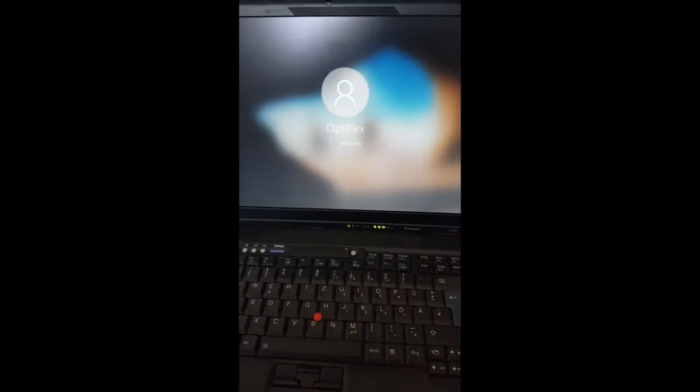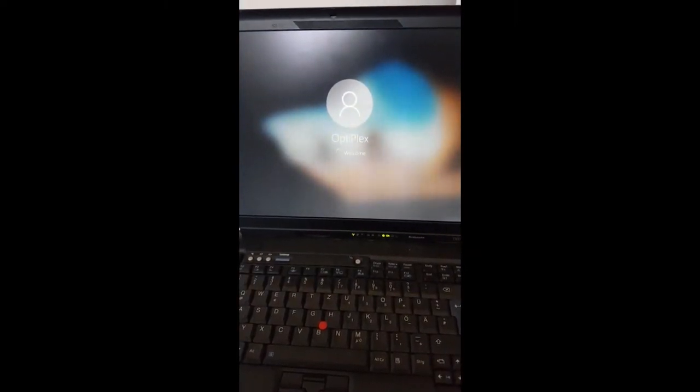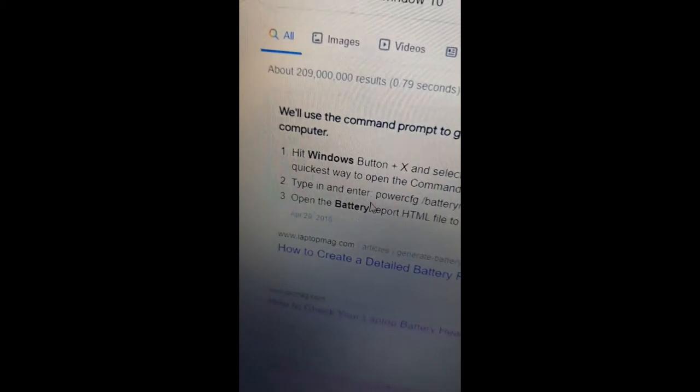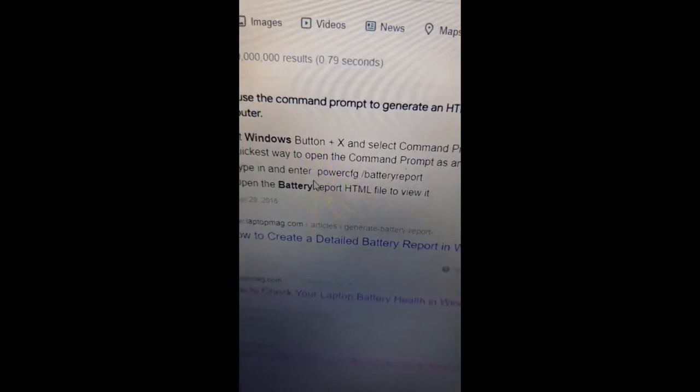And then we'll run some battery tests to see the real capacity of this battery. It says 8800. Now we will see, is that true? What it says in the description. So I'm gonna pause this until the laptop boots up. Okay, the laptop is booting. Almost there. Then we will go into the command prompt and use this command, powercfg /batteryreport. Let's go do that. Let's check over here.